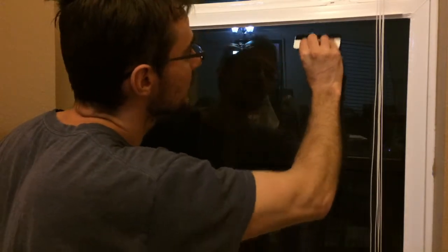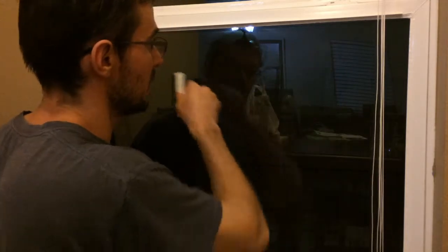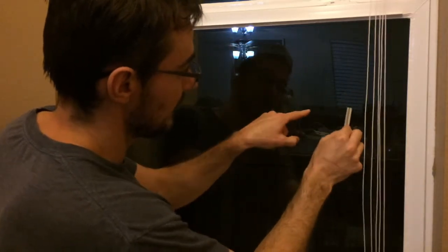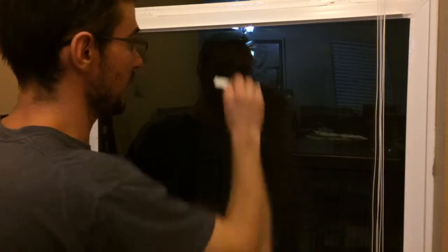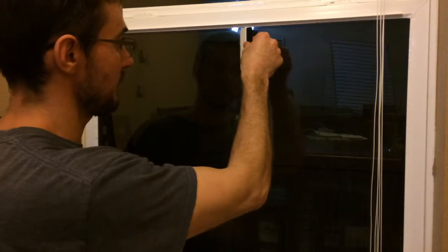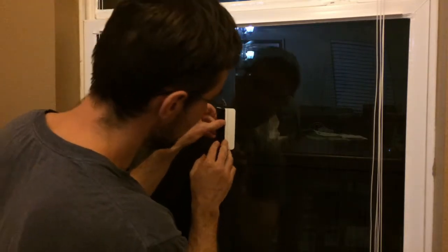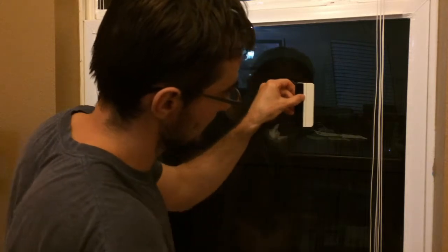I found bubbles that were left over and kind of pushed those out real hard, then did one final pass. The problem was I wasn't consistent. After my first pattern I pushed most of the water out, but there was still some invisible water. If I took a bubble out here and pushed it, anything trapped in there might now be locked in. So what you need to do — I did three sets of passes — is get progressively harder each pass. I started medium with the trailing soft edge, then covered the hard edge with a paper towel and put a lot of pressure, almost like a knife cutting into it. You could feel the film stretching a little bit, and even though I couldn't see any water, I'd pass it and occasionally see a bubble or a little wave develop in front, and I'd push it out.